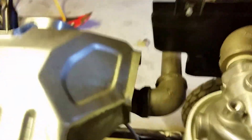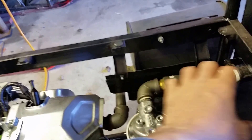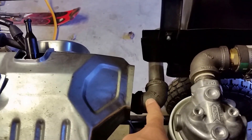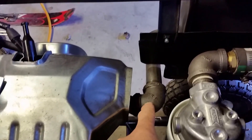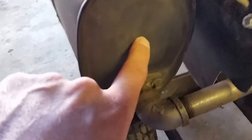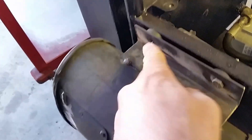What I had to do here — as I mentioned in the other video — is the exhaust came straight out and sat right in this area, which would have been a problem: it would have run right into the side of the tank. So I cut it and welded on some black fitting — you've got to heat it up before you weld it or you'll crack your welds, it's just a casting. Then it goes over, 90s, with the other fitting I cut off from the muffler, a black pipe 90 on the other end, and I've tacked that up there. So the exhaust comes out the side now.